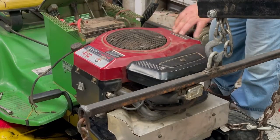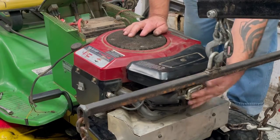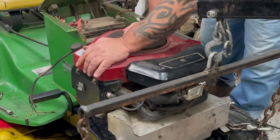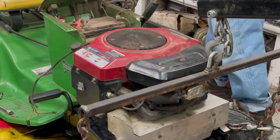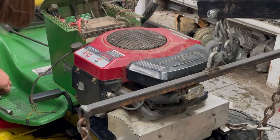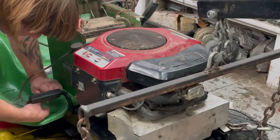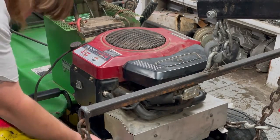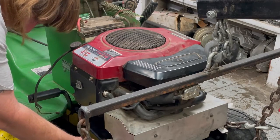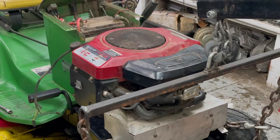Because on the original motor, the line went in on this side here and it goes through here, then it goes to the fuel pump. On that other motor, they had that fuel pump over here plus the one up front. I don't know what their thinking was on that. But on this back bolt here, we have them two ground wires we have to line up. There we go. Well, I think that's going to work, bending that pipe up. I can, like about a ½ inch above the frame. And I believe the hood's going to be like right here, so that's going to be good there. Cutting that pipe and turning it like that.